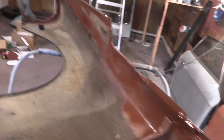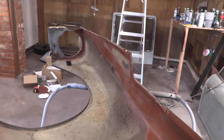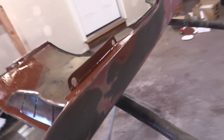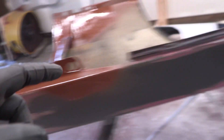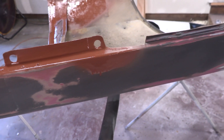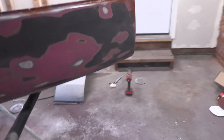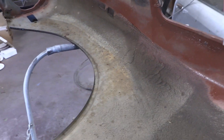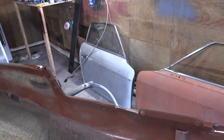We've removed all the surface rust off the inside of this panel and hit it with the rust reformer spray - that's gonna be good. It's a rust-reforming primer meant to go over rusty panels, and then we'll spray over that. What I did on the top here was just hit the rusty spots - there's one here, a couple of holes, a little bit here and there. When we sand again, the rust spots are low where it's actually corroded away from the metal, so all that'll be left will be this little primer stuff. Interesting order of operations - this panel needs to dry now and wait, then we're gonna have to bring it in and do some welding. We need to spot weld this spot shut right here where we're actually eaten through, and then we have a couple of bolt holes. So then we'll do welding, grind everything down, and then do our body filling. Time to move on - I'm honestly a little bored of fenders, so let's move on to the door.